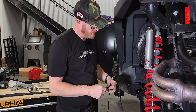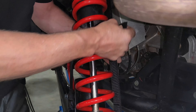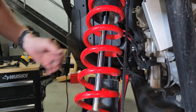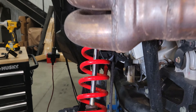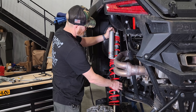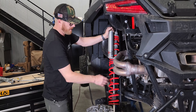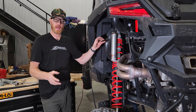We've got the top and bottom bolt torqued. Grab your spring strap retainer, feed that in four or five coils, velcro that — it's going to help keep the strap from flapping around. The rear is pretty easy and simple. Short spacer on top, long spacer on the bottom, torque those to 70 foot-pounds, and put your strap retainer on.